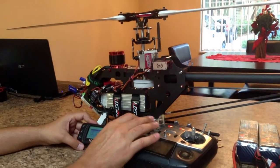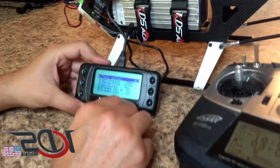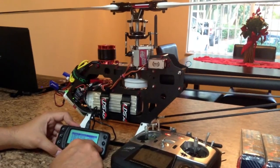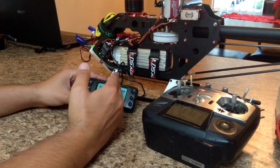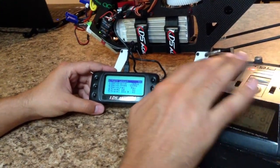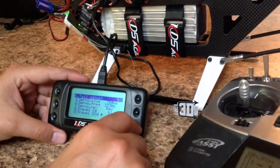Going to travel — clockwise and counterclockwise. Move the stick clockwise and set the limit. In my case I have 61 for both clockwise and counterclockwise — I centered my servo arm as much as I could so I have an equal number each way without binding. I have 17 millimeters on my tail servo arm and 20 to 21 on the cyclic.